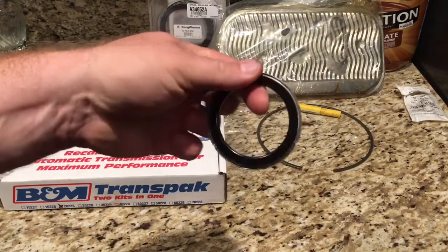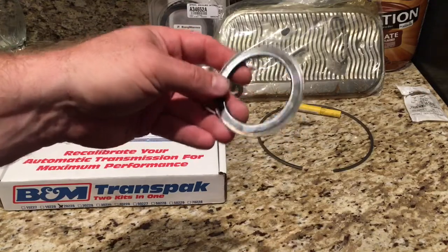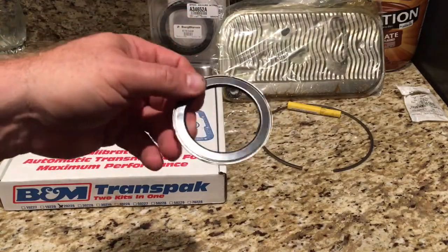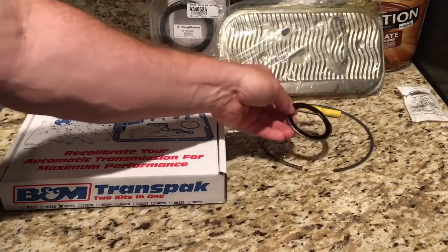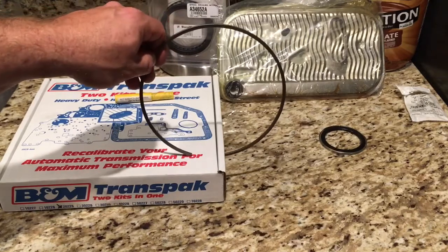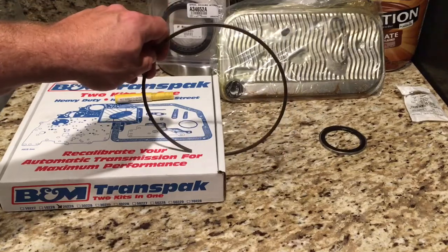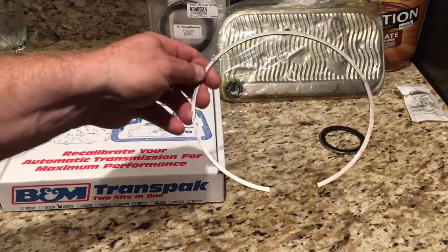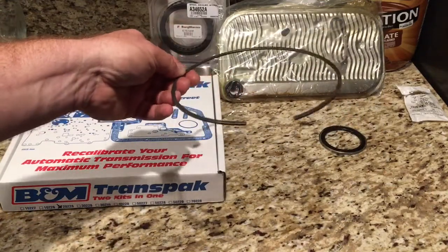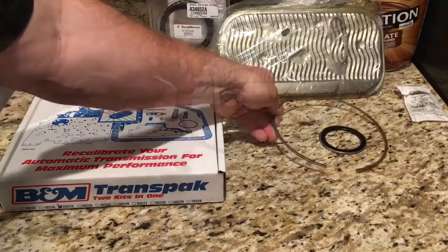This is the turbo 350 main pump bearing — basically a Torrington bearing that you use if you're going to rollerize the rear thrust on your turbo 400 build. If you look on my channel you'll see the videos where I talk about rollerizing your case for the turbo 400. The crankshaft coalition turbo 400 recipe recommends finding a 95 to 100 thousandth thick case ring — this is a 95 thousandth case snap ring to hold in the forward clutch pack.